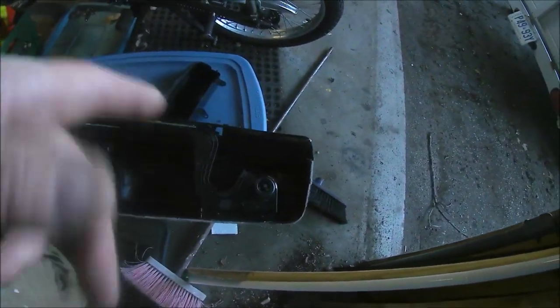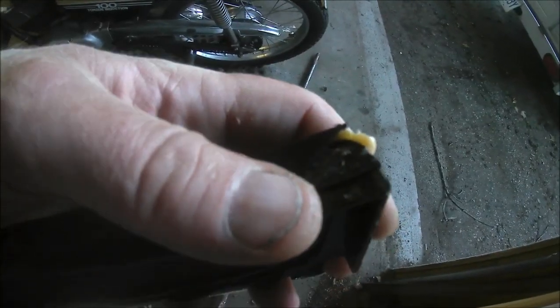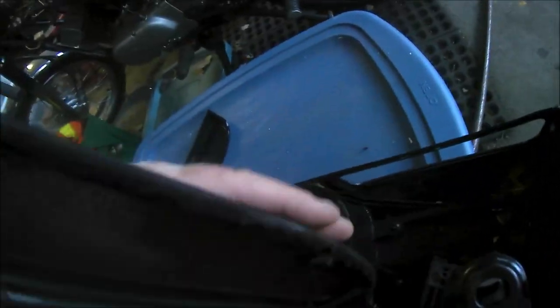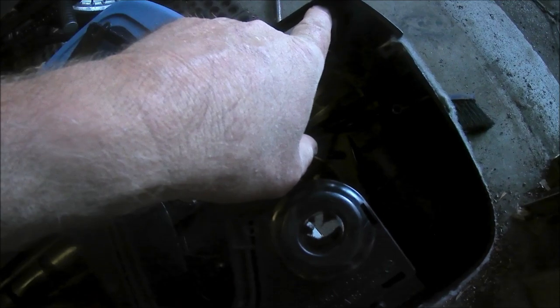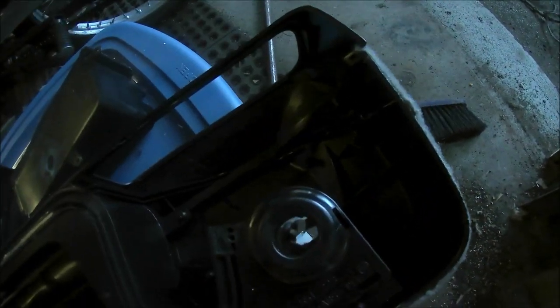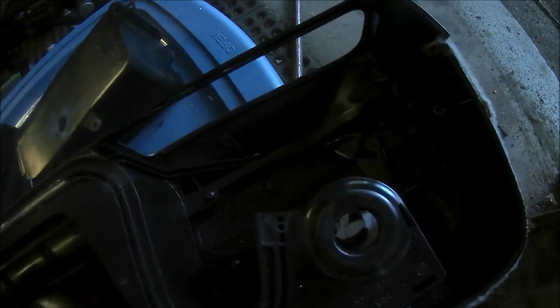Okay, I didn't really show how to get the old parts out. I did it in the winter time when I ordered this. You can see this little glue remnant here. These sit in with three T25 Torx screws, and the fronts are glued along this edge with really brittle glue. You can just grab a utility knife and score it and cut it and pop it out.